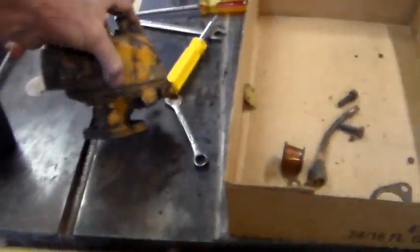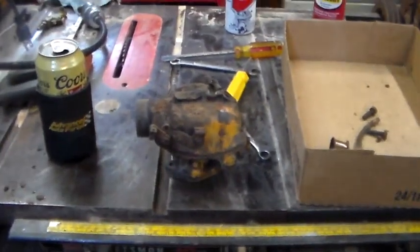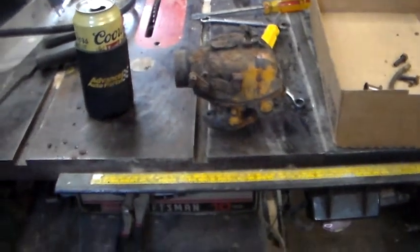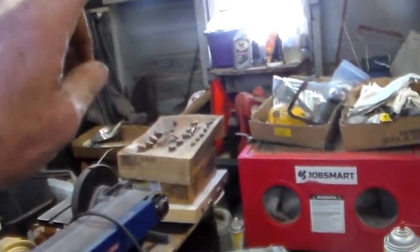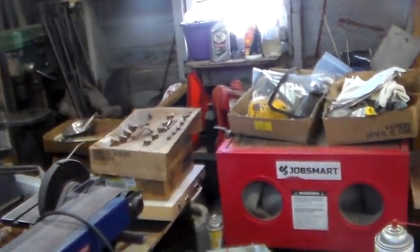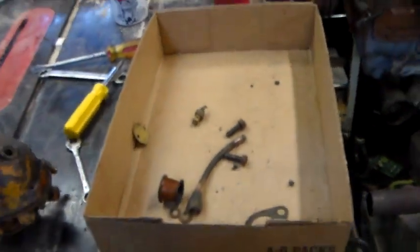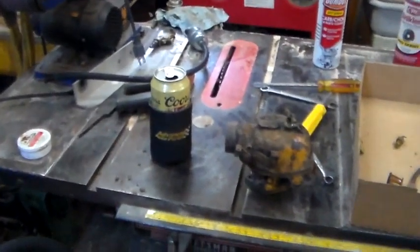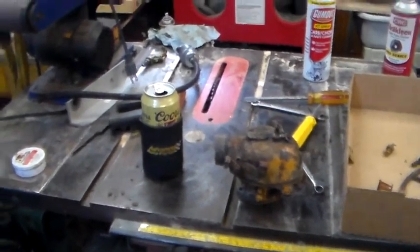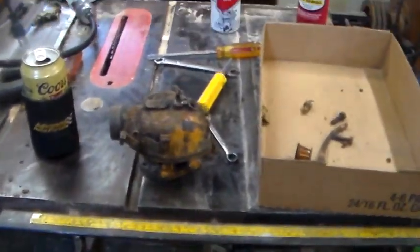But anyhow, right there it is, the carburetor for the ZA, about 87% ready to go back on. So I've got to dig through my pile of carburetor kit leftovers, see if I've got a gasket for the main needle and seat, and then hopefully hear back from my carburetor guy on what to do with that throttle shaft, and we'll finish getting it together. I may just say good enough for now, put it all back together and hang it on the tractor.